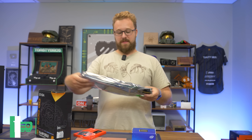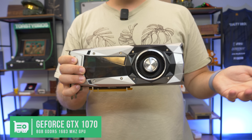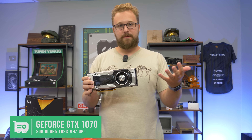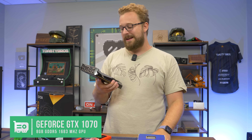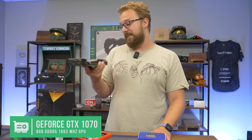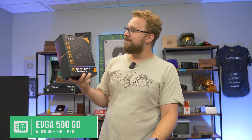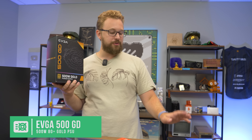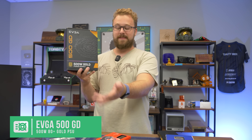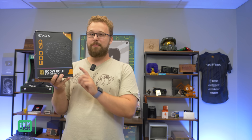For the GPU, as mentioned, this is the GTX 1070 — an old reference blower-style card. You can buy some aftermarket ones with two or even three fans that are a bit more on eBay, but this one delivers the best price-to-performance and still cools well enough that you won't worry about overheating. For the power supply, we have the EVGA 500W 80-Plus Gold. More than enough juice to power this 1070 with a slight upgrade path in the future — though if you want more headroom for higher-end GPUs, you might want 600 watts.